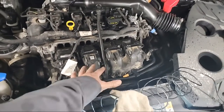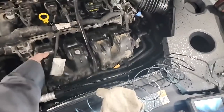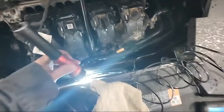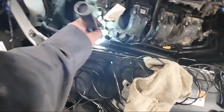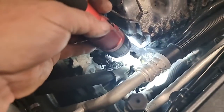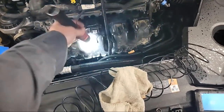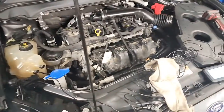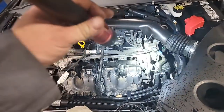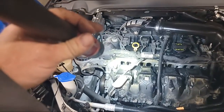Or you can pull this manifold all the way out. Undo your sensors — your MAP sensor and anything attached to it — undo your MAP sensor and this manifold will actually pull out. Pull the tube going from the lower intake manifold down by the throttle body, unplug that throttle inlet tube, take that tube off and pull it out of the way. Unsnap the tubes from the intake manifold, undo your clamp at the throttle body, and you can pull this intake manifold right out of there in about 20 minutes. Then you can work on the head without worrying about all this. I'm doing it in-chassis just to show how easy it is.